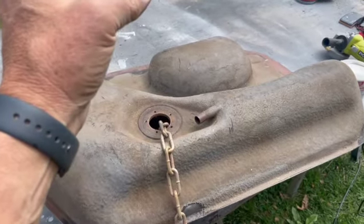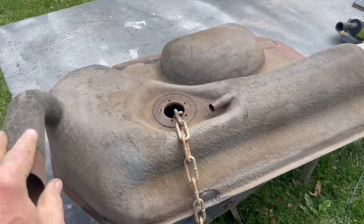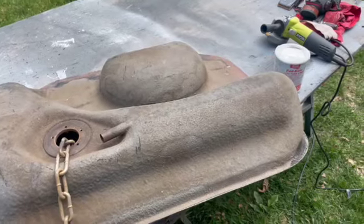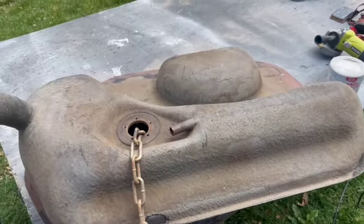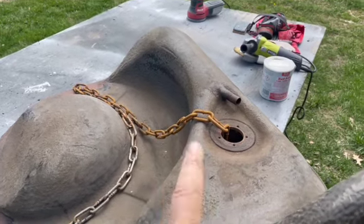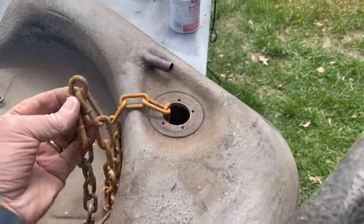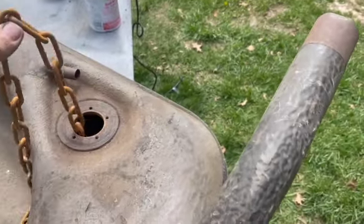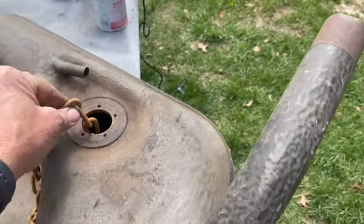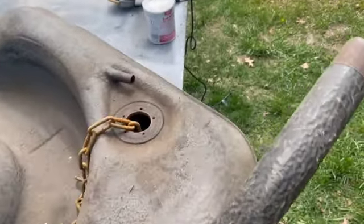We may end up putting some nails down in there and getting them back out with a magnet, or using rocks and marbles — I've seen all kinds of things on Sleeper and Vice Grip Garage. It's not really how the outside looks that matters — it's how clean the inside gets before you line that tank. Just a one-man show here, don't have the fancy camera tripod set up. But this chain has been in the fight — it's not loose, it's doing what we want. You got to catch your breath every once in a while, shaking, rattling, flipping, getting all those little chain links up against the inner walls of the tank. This is going to be a fun day.